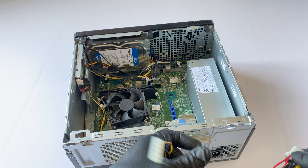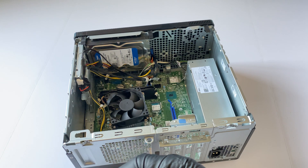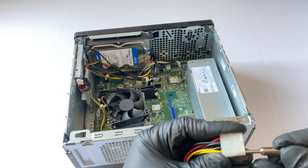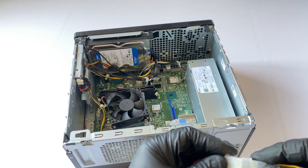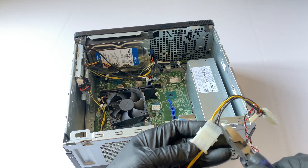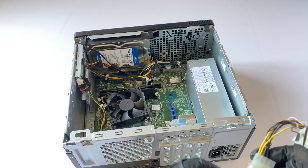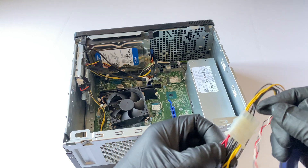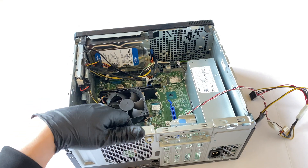I'm going to show you how to switch out the fan wire. You remove the molex pin like this — it comes in and comes out. If you can't get that tool, you just have to use pliers and cut it. You switch the wire from the yellow 12-volt line to the red wire, which is 5 volt, so the fan will run very quiet.